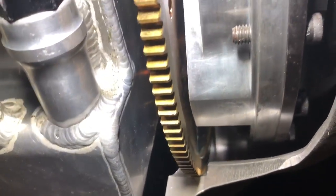So what we did is we cut about 180 thousandths off of it. He shaved a little bit off the pads, and we just got it all back installed. You can see we've got a pretty thin mid plate — it's not huge. We just got everything all bolted together, and now we're checking torque converter clearance.